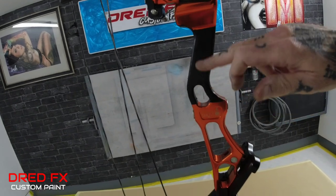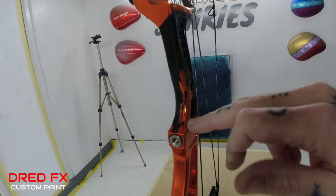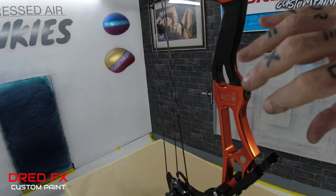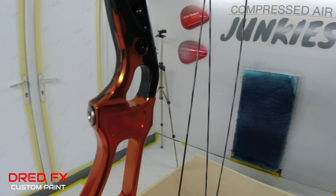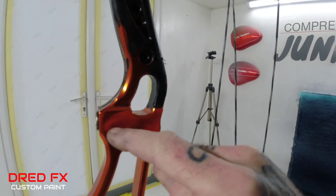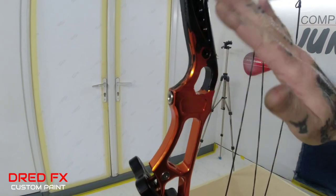As you can see, this black handle here - the customer had a go at painting it and I've just wiped it off with a little bit of thinner so it's coming off. We've got to clean all this black off and then properly get this sanded up correctly to put the primers down, like an etch primer down, which will adhere to it. Then we can go with the black base coat and then it will be a satin finish on the handle. Where you've got the logo on this side, this side's actually blank, so the customer wanted the same logo but in color. So we're going to get a miniature sticker made because this is absolutely tiny here, get an inlaid sticker in there, and we will clear over that piece and seal the sticker in. So now stick you in time lapses, enjoy the video, see you in the first time lapse.